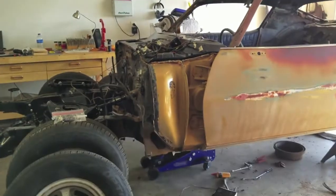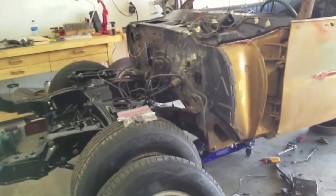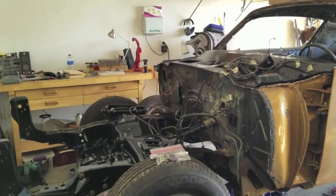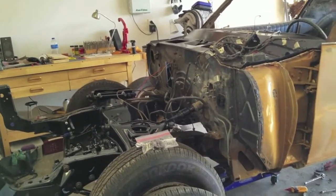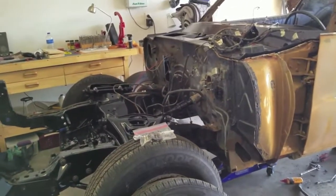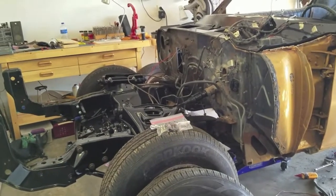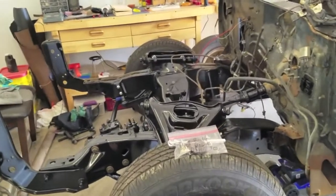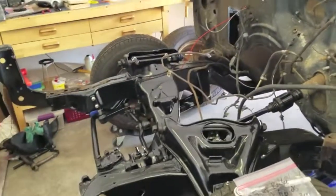I did want to add that while she ran, she would get really hot and basically puke coolant everywhere. It turned out that the coolant had gelled in the line on top of the thermostat, and it was basically just a big mass of really hard, large granules of ancient coolant. I got a couple pictures of that. Definitely weird, but that for sure explains why she was running so hot.